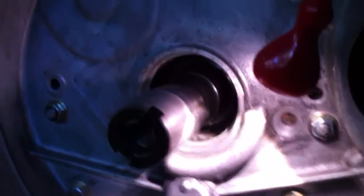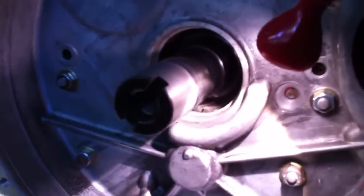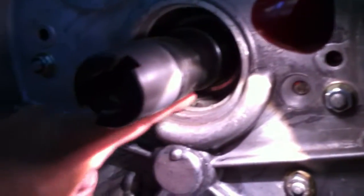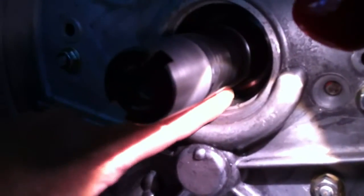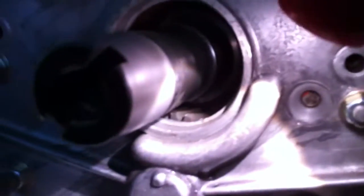Now it's harder to do this with the engine and gearbox together because obviously you could reach around the inside, but it is accessible here with the primary gear and primary seal not in place. We can see that without this being super tight, this gear does not move — it has no clearance, pinched tight between the housings.